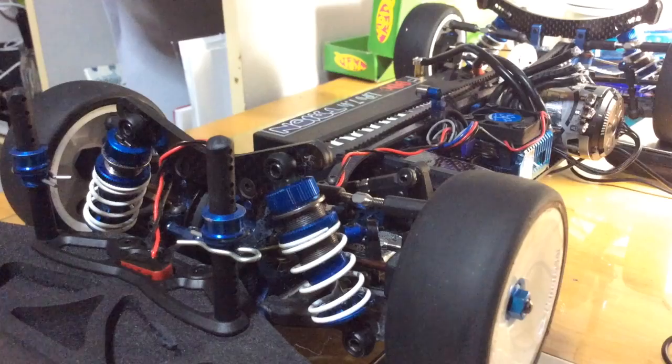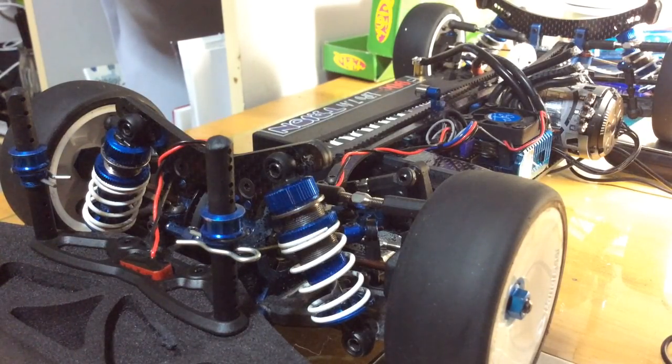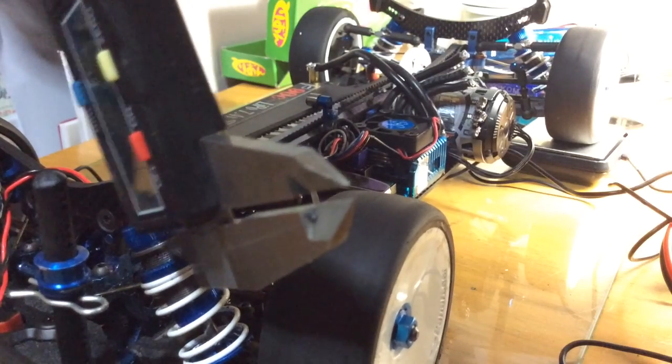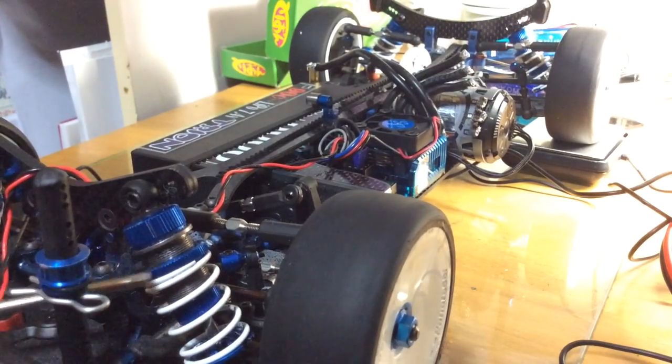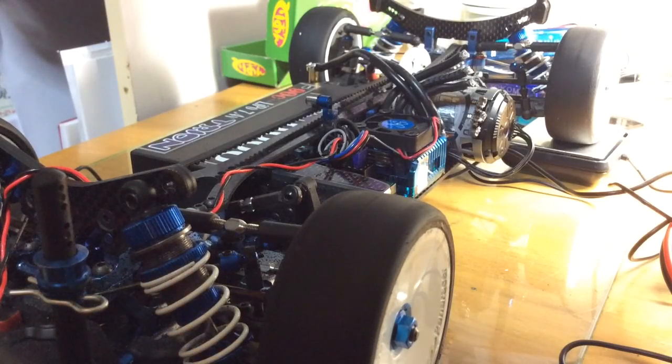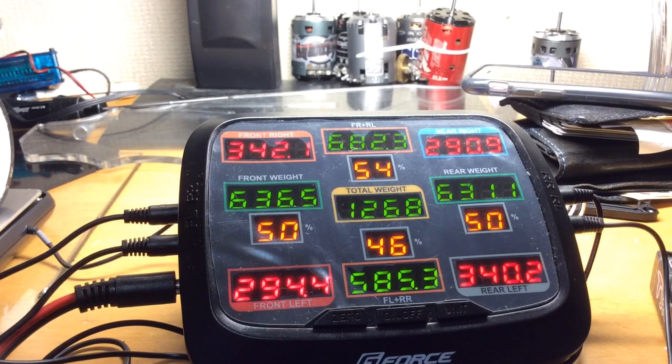Let's just look at the car here. I made sure that my ride height is 5mm front and rear, and I've taken my digital calipers and measured to make sure that the spacing of the collar into the top is of equal distance. For demonstration purposes, I've adjusted the collars substantially so you can see how the suspension will come back to a 50-50 setup.